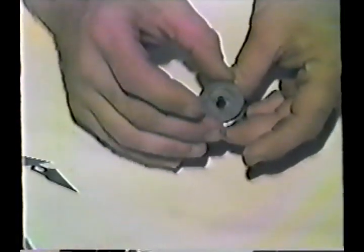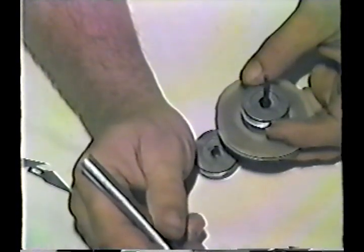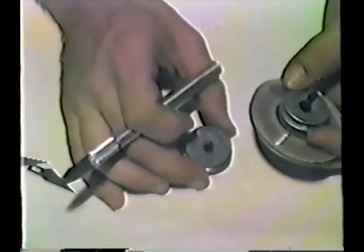And what we have here is the little pulley that goes on the record. Now the reason I said not to pull up on this pulley is because when the factory made it, they put it onto the stem and just punched with a special punch some edges to hold this in. And if they're a little bit worn, when you lift up on this, it'll come off just like this piece has.